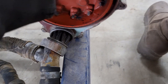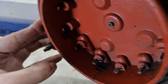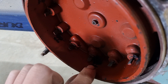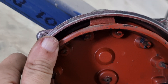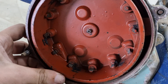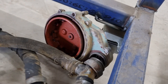When we open this — it goes on the other side of the magneto — this is the cap. We've got nice burns in the side, here and there and on the other side. So that's been mistimed completely. More problems there.